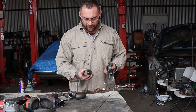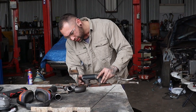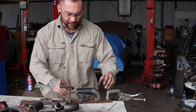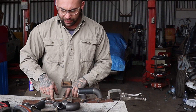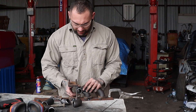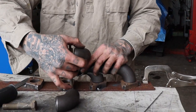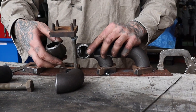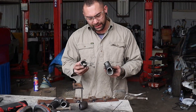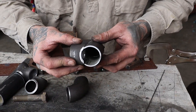I've cut out my merge piece — I've got this bit that'll sit there, that bit will sit on there, and it should all interlock like that, which it does nicely. I need to make two of those, one for this side as well. That's my merge piece which will go up on there, joining the two banks together nice and even. Then my 90 to go onto there, followed by another 90 which will go there.